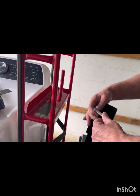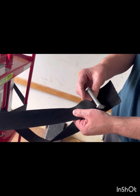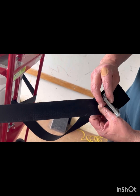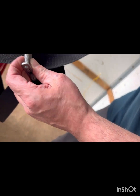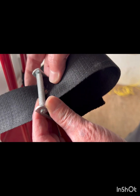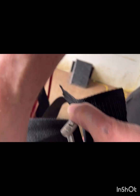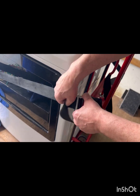When you're applying the buckle, make sure the strap is straight the whole time. Put it to the bottom, underneath the two rollers, like that, and then straight. Make sure that the strap's straight and goes through the middle of the rollers. And that's where you get your tension.